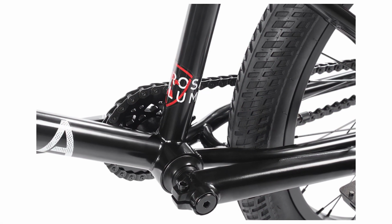And again, just like the lower handlebars, for a taller rider, this might feel a little bit uncomfortable. For someone over 6 foot, they generally want 175 or 180 millimeter crank arms. And the 170 might feel weird. So just like the bars, if you feel a little off when you're pedaling, something doesn't feel right, consider getting longer cranks. I'll talk about it in a minute, but these are 48-spline cranks. They're full chromoly, but they're heavy and chunky. And so this might be a good excuse to buy some aftermarket 48 spline cranks.